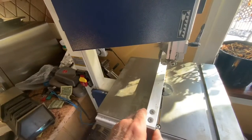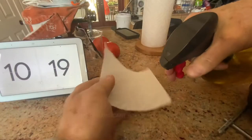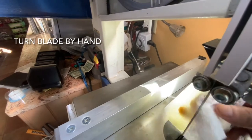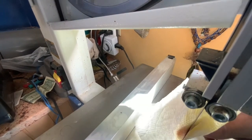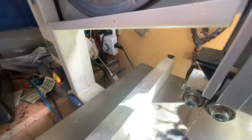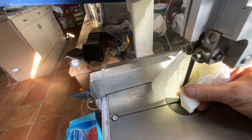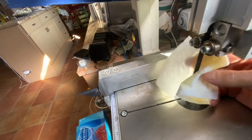I'm going to apply olive oil — which was a key learning experience — to coat the blade. This is the standard blade that came with it. Coating the blade with olive oil lubricates it so the bread dough does not stick. I learned that even a couple days after baking, the doughy texture inside the loaf will stick to the blade and cause it to derail from the turning pulleys. So I spray olive oil on paper towels and rotate the blade by hand — you never want to use the motor to turn the blade, that's very dangerous. I also learned you have to coat both sides of the blade; coating only one side creates an imbalance on the pulley and it will come off.